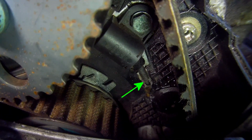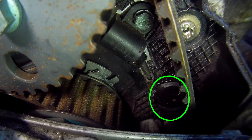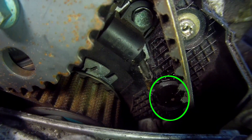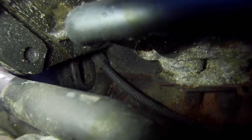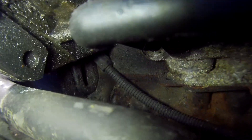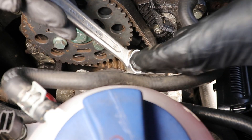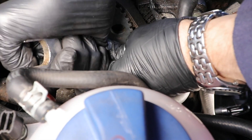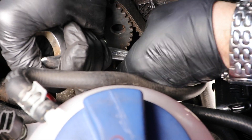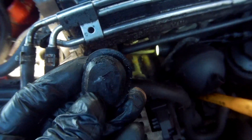The cable protruding from the rear of the sensor fits into a little slot on a cover backing plate, which comes out halfway down the block on the front of the engine. To the bottom right of the slot is a little plug that you need to take out to remove the sensor. Knock the plug out from the cam belt side with some sort of blunt instrument and just push it out. It's made of tough plastic, not rubber, so you need a bit of force and it should just pop out.